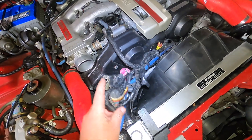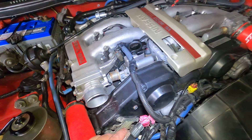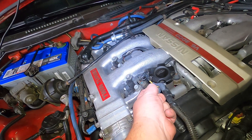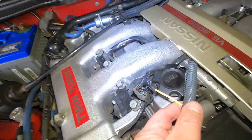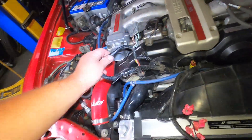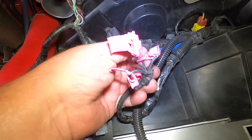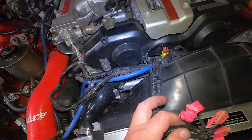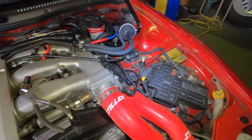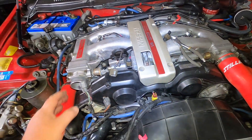So here we've got kind of a rat's nest going on. What I'm going to end up doing is disconnect all of these. There is one lead that comes up here to this ignition coil, and it looks like I'm just going to end up snipping that one because it looks just like a bad splice. Phase one down — it looks like I've isolated the harness. I removed all these little crimp guys. I'm going to follow this harness all the way over to that high power box, take it out, and put it in a box and save it because that is a piece of this car's history.